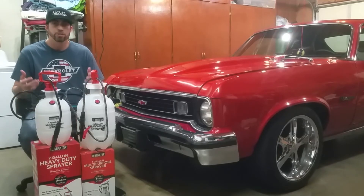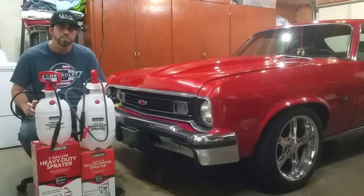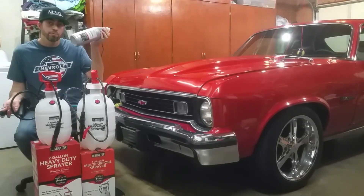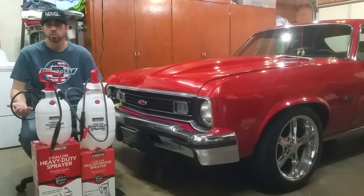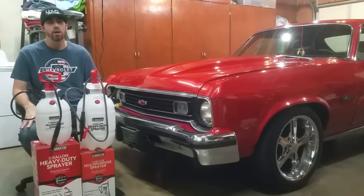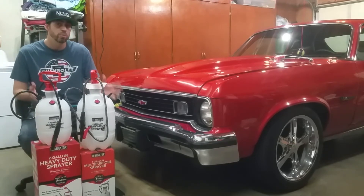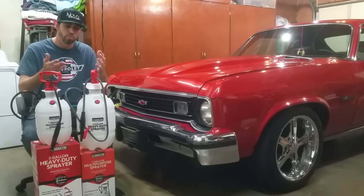There you have it — my fluid transfer pump idea actually worked. Pressurizing the system with my compressor and a tire pressure gauge setup makes my life a whole lot easier. I created two of these: the small one is for the differential, which holds about two and a half to three quarts — I can put it all in there, pressurize it, pull the trigger, get it all in in one go, and when fluid starts to flow out just pull the tube and put the plug back in. For the transmission, the 6L80E in my Nova holds about 11 quarts, and this big one — the biggest I could find — holds eight quarts.